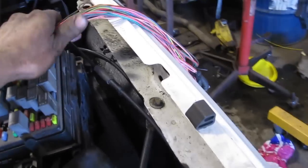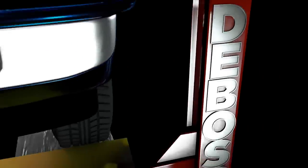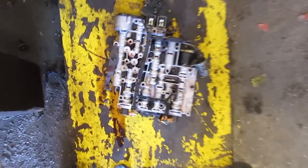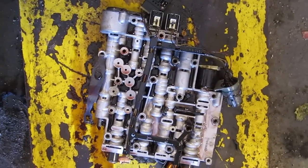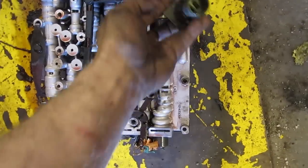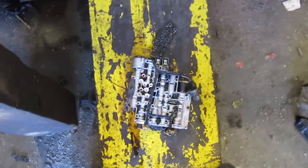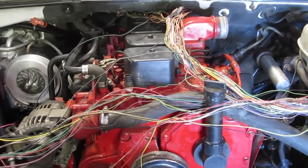Everything else is not necessary anymore. These are all the fuel injection system wires that hopefully we don't need — these are output signals from the computer. If the reduced engine power doesn't come on, we're going to cut those wires and clean up the harness. We have to unplug the valve body from the transmission and use our Bowman shift controller. I've grabbed the valve body from a blown-up transmission and I'm going to plug this in and tuck it underneath somewhere so the truck harness still thinks it's got its proper resistances to keep the reduced engine power off. Hopefully that works — otherwise I'll have to go to GM and see if they can reflash the computer to eliminate all the sensors.